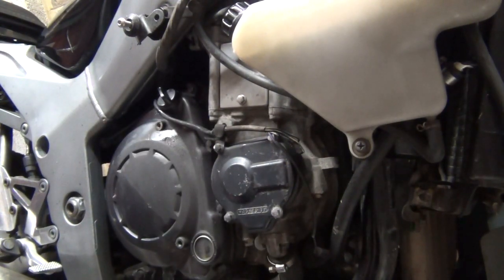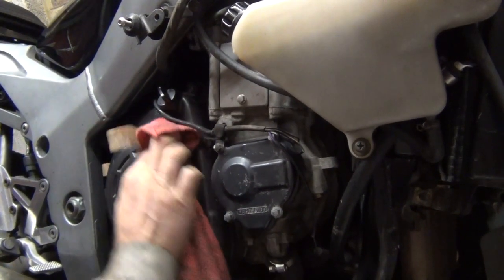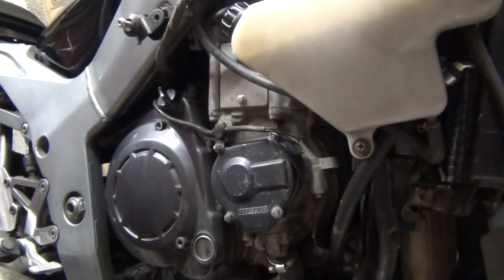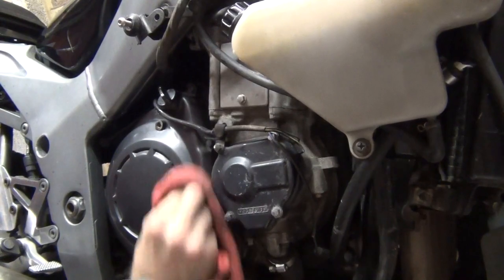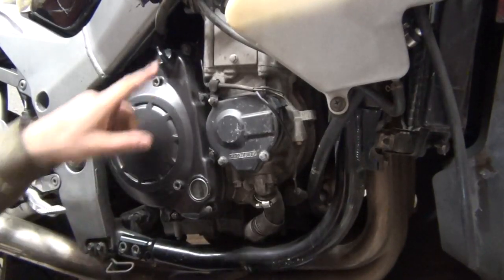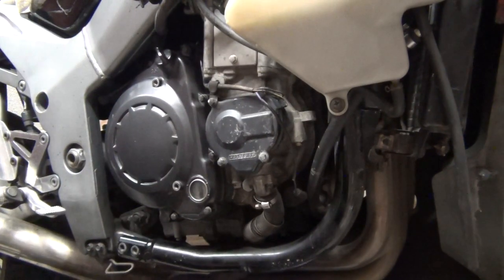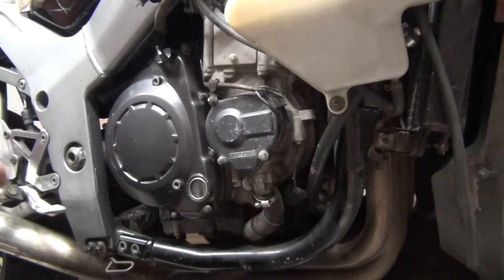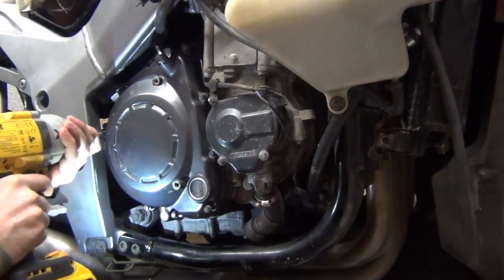They say you need to remove some or all the oil, but I don't know if it's actually necessary. I'm going to just put a basin under the engine and hope that's enough. There are ten 8-millimeter bolts holding this clutch cover. I got them loose with the ratchet and now I'm using my impact gun to quickly remove them.